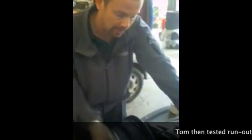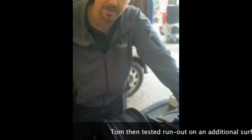You can see the wheel spinning and the needle making only about four thousandths runout. Now in the industry, fifteen thousandths will not vibrate on the car. So we're way under spec — this wheel is easily in spec. And there's no argument at that point where the dial indicator measures to the thousandth.